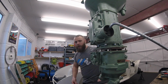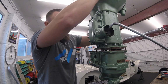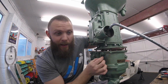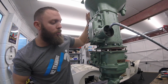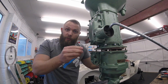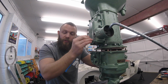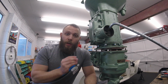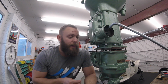Right, at this point, we will need 2 plain washers and 2 nuts. Push the gearbox down to the point that you can just get a nut and a washer started. Only plain washers for now, and then what we'll do is we'll tighten the 2 nuts uniformly and evenly, and then march the gearbox and adapter plate down to the overdrive. If at any point it binds, you stop, take it apart, start again and check why. Let's have a go.